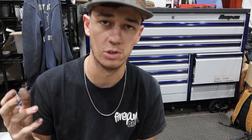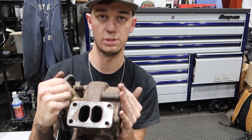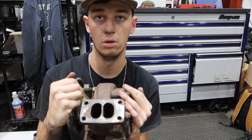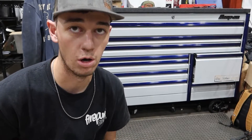One of the main things I'm going to fight is the downpipe going back on. As the picture shows, the V-bands on the back are the exact same size on the HX35 12cm and the 21cm H1C. This charger is also a WH1C, very similar to an HX35 but not quite the same internally. However, the housing will sit farther back towards the firewall, so you have to struggle with that downpipe a little bit.